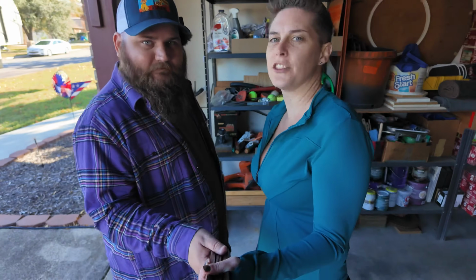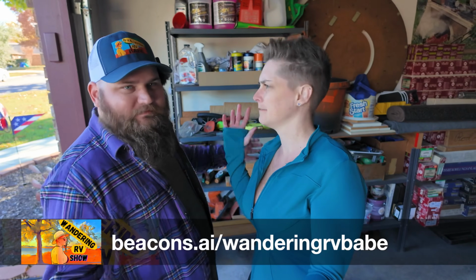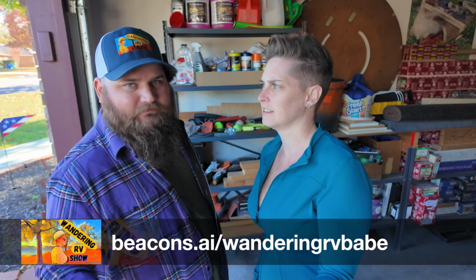So today's sanitization day. We gotta sanitize the RV. We try to do it once a year. Well, sanitizing the tanks. Yeah, and the lines, and all the indoor plumbing. It's part of the normal RV maintenance stuff, and it's a lot easier to do when you're mooch docking like we are. We're gonna spend the night in the house tonight and leave it over 12 to 18 hours. Some people say 8 hours is enough, but we're gonna leave it for 12 plus, so it'll be fine.